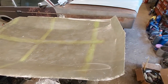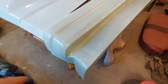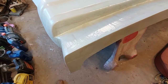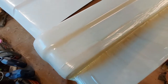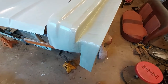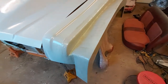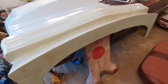Once that's on and dry, you mix up gel coat — this is a different kind of gel coat I used this time, and I don't really like it. You can see the green right there — that's the liquid PVA after it dries. It's colored green so you can see it as you're putting it on, unless you use the neutral color resin, which makes it difficult to see.